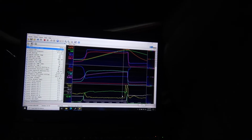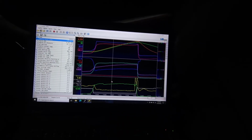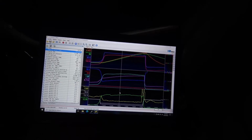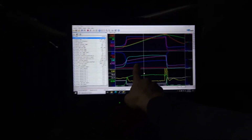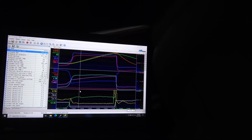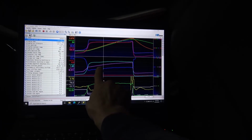So there I hit 21 degrees. We're still going to be able to put more in it. You can see the knock sensors. The knock sensing on these LSAs is very accurate, and I'll tune them right up against the knock sensors and then dial it back just a smidge. So yeah, I'm going to add some more timing, probably just across the board, so this ramps in sooner.